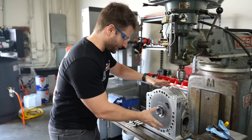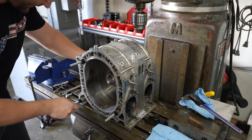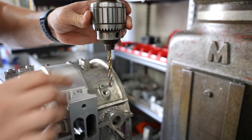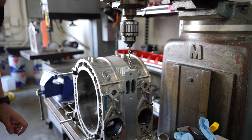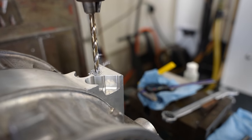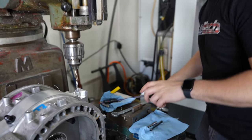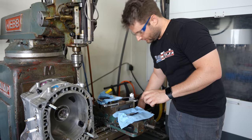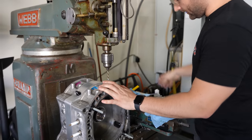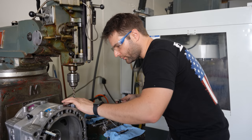We're going to go ahead and use our same little setup that we did in the CNC mill. Here are our little all-thread bolts. So this is how insanely close this is. Drilled it right as far as I can, whenever the teeth almost start to go up into it. That is the maximum height of everything — the head, the table, everything, all the way back. There is hole number one. And we're trying to hit that 1.1 inch, so we go back to the old-school method — 1.1 inches exactly.